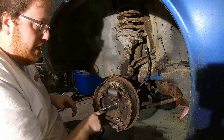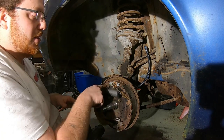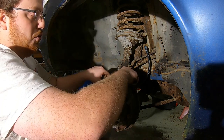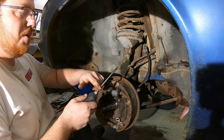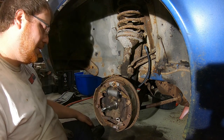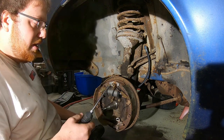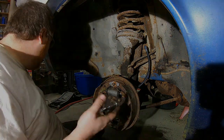Anyway, you have a master spring here to here that holds the back half of them together, and you've got a spring here, here, here, and here, or two of them hooked on each side. You just need pretty much a bar with a slight bend and a hook on it, or I've seen people use vice grips before. I don't like doing it on the big brakes, but those are 10 times easier than these, in my opinion.